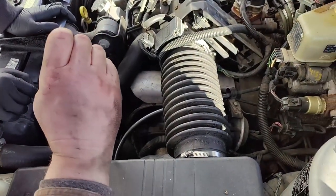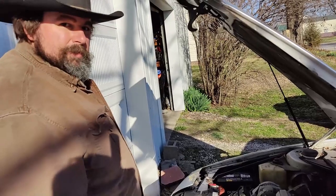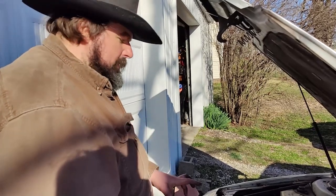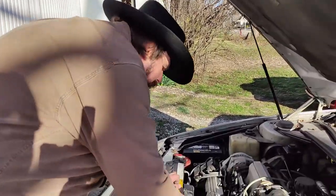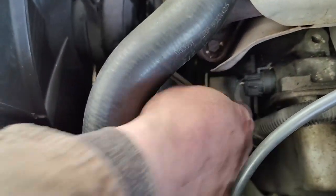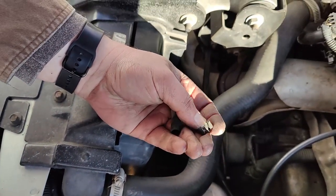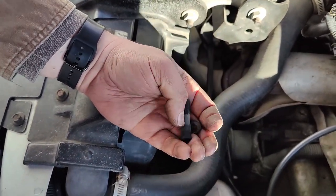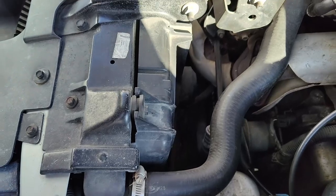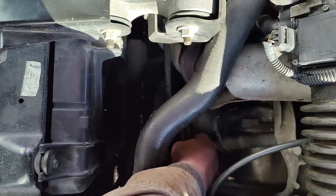This line has disconnected from wherever it was connected when I was messing with it, so now we've got to figure out where it was connected to. Going through while he was doing the diagnostics, me and Kit heard hisses coming from under here. We tracked down the hisses to coming from this control relay of some kind to these two vacuum lines, and then back to the air feed tube under here. They had connectors that were — well, you can see that one's completely falling apart. There's more to that one. And this one is gone. So they weren't holding anymore.